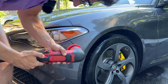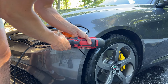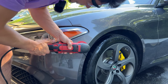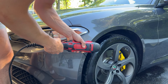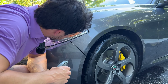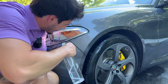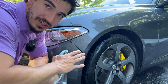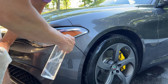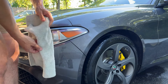Alright, you do one pass — I did like 14 on accident, I wasn't really paying attention. It looks like it's already out but we're not quite done yet. There's still a little bit of the scratch there but it's not nearly as visible, which is good. I could go ahead and run it through one more time. What I'm going to do now is take my IPA mixture, spray some on — this dissolves the polish — and then just wipe it up with a new rag.